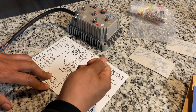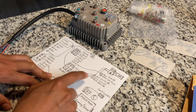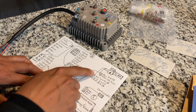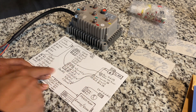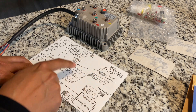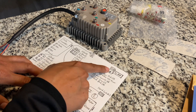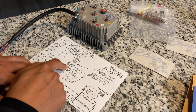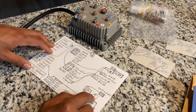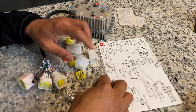When you turn the key, it completes a 12-volt circuit that signals the controller to turn on. The other three wires are the functional throttle portion: red on the throttle goes to lavender number 4 on the female nine-pin connector, green on the throttle goes to green number 3 on the controller, and black on the throttle goes to black number 20 on the controller. The speed controller I'm not going to hook up for now because I can't find information on how to do that — if you know how, please comment below.